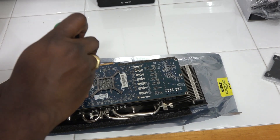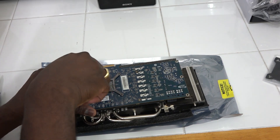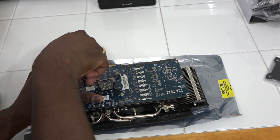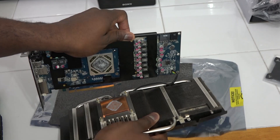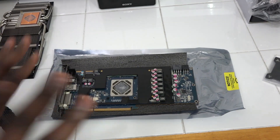Moving in closer, you're going to take off all the screws and you can see it's a very simple process — there's nothing to strain here. Once you take all that out, you can separate the cooling from the card. Pop it up, make sure you unplug the cooling fan, and that is your GPU center.